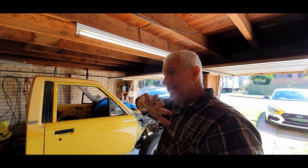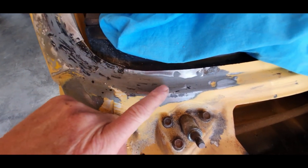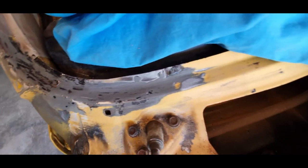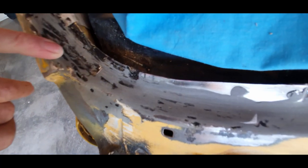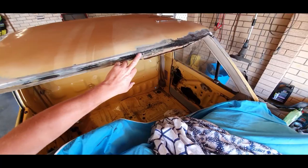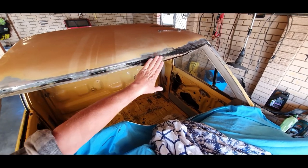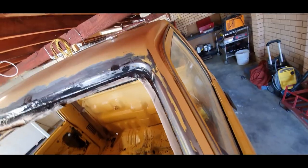G'day, hope you slept well - I know I did, because I've got the majority of this now sealed up. That hump just keeps eluding me but I think I'm getting there. I've already been up this morning tinkering away on the old Ningi Nugget. Let's have a look at the results of yesterday's patchwork - this is what it's going to look like. We've got a few little high and low spots to even out. There's a couple of really small holes still here so I'm going to run another skim of panel adhesive where the big hole was - that's all solid now but it's a little bit inward, so I'll fill that again and sand it back.